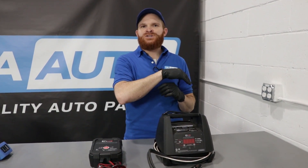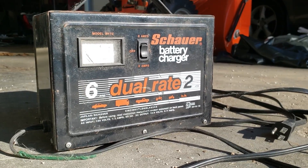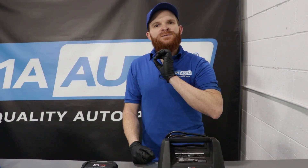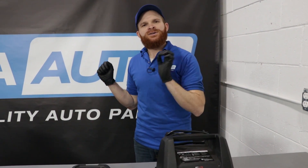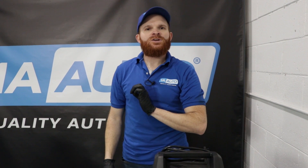Now when we're talking about chargers, it's important to remember that there are different types. Some of them are smart chargers that know when the battery is connected and when it isn't — they also know the charge of the battery and just how much amperage to put to it. Other chargers, which would probably be the older versions, you pretty much just hook these up, plug it into the wall, turn a little dial that says on, and then it starts charging that battery. That's great, but it doesn't stop charging until you go ahead and turn that switch off and unplug it. So if you were to turn it on, walk away, and come back out — maybe you smell a weird funny smell in the air, you walk up to your vehicle and the smell gets stronger and you can see little smoke coming up. You lift up that hood and now you really get a smell and more smoke — at that point you need to be very worried. You need to run over, turn off your charger, unplug it, and then get your vehicle into a well-ventilated area. If you're inside a garage, open up that door as far as possible and get as much air in there as possible because you're overheating your battery and it's starting to boil inside. Once that happens, you've caused detrimental damage to your battery.